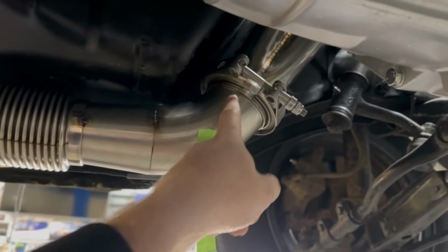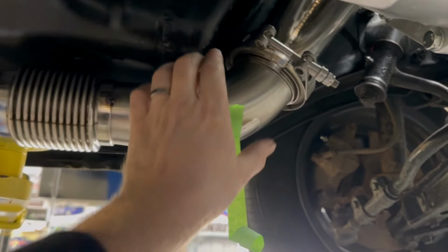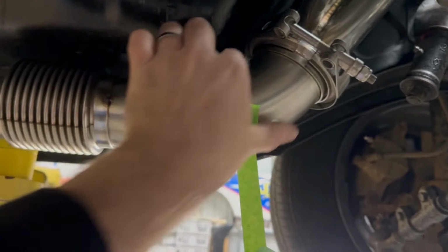A couple mufflers in this one. I've done at least one video on exhaust before, the VN exhaust, but that was very basic, no mufflers and stuff in that. So far, I need to put a muffler in it still. But pretty straightforward: headers, collector, V-band, 3-inch to 2.5-inch. The reason is I could not get a reducer and back down to 2.5-inch coming out of there.